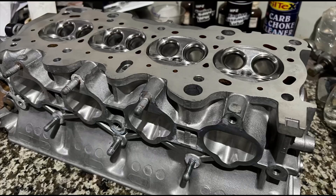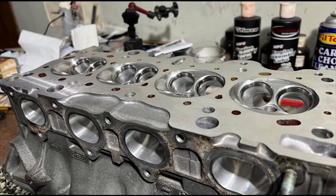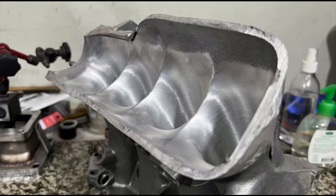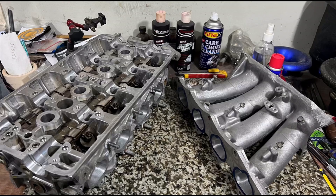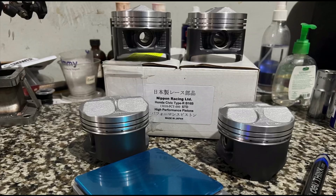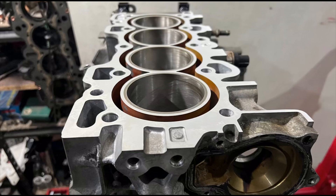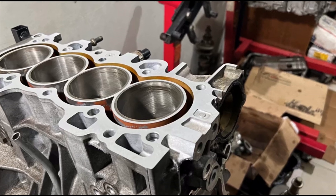Last episode we were working on the head and the manifold — now even the head is done. We touched on the chambers, here's the intake manifold, it's all good and ready. Next up we port matched the manifold into the head with a gasket we made. The pistons arrived and now we're balancing them, and we're gonna have them pressed to the rods. The block is freshly honed and decked so we can check the ring gaps and assemble the crank.